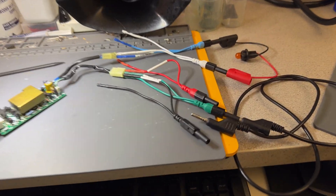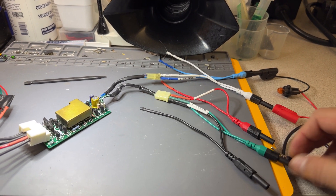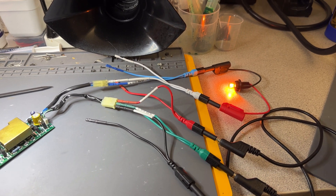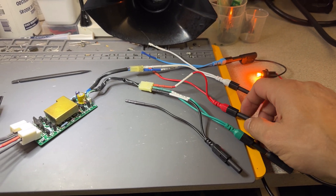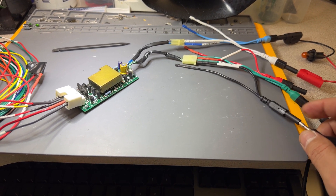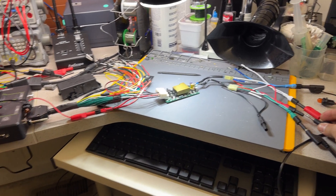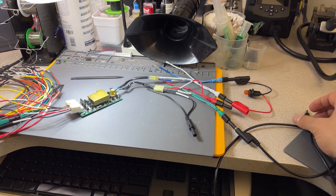Everything is ready to go. I'm going to become the shift switch by engaging these two — and the shift lock solenoid is now being powered up. So power and ground applied by this module is good — fantastic, because this was not working. Now the next test: the common is the green, the other side is the key interlock release. Now when I remove that from there it goes off, and when I go over to the other side the light goes on — that's exactly the way this is supposed to work.